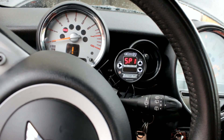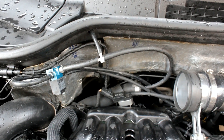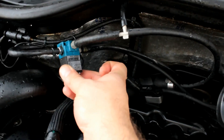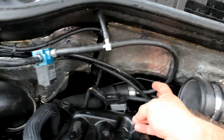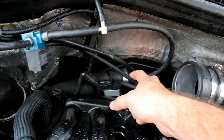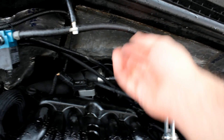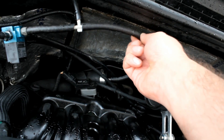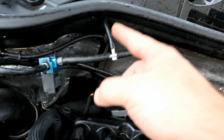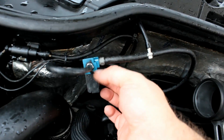You basically pick how much on-off ratio you need for the way your boost is behaving in your setup. So here we are under the hood, and this is the Turbosmart 3T. We're taking a reference off of where what was called the noise maker on the factory install was, and have capped that and put a tap on so that we can get the reference signal for what boost is. This T here sends to the inside of the car so that the boost controller can know what the pressure is, and then the rest passes through to be T'd.